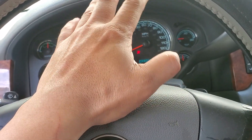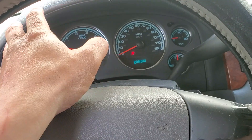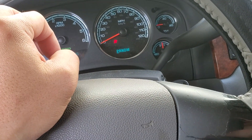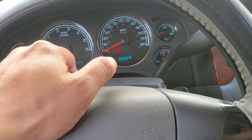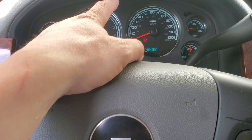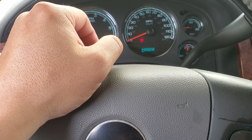Two or three days ago I decided to go to AutoZone and get the correct dipstick for this car — that's really important. Then about two days ago I put in about four more quarts of engine oil and started getting that light more and more. That's when I thought about it and realized it was probably overfilled — too much oil.